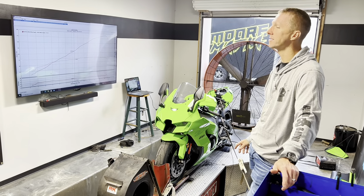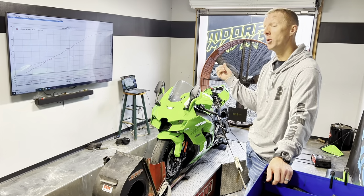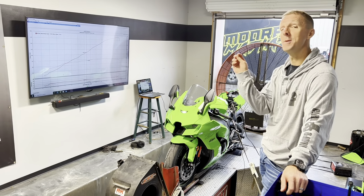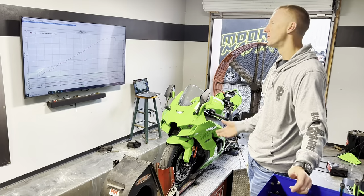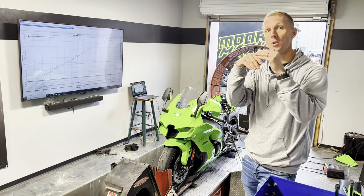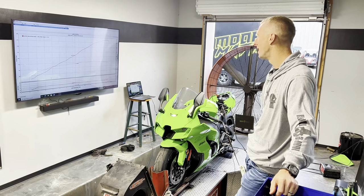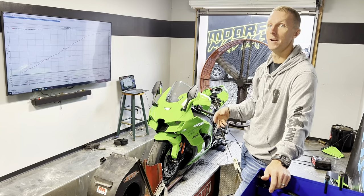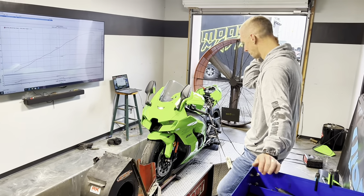So in tuning these things, I'm not going to say it's easier than people think, but it's common sense. The fuel injectors cut off when you let off your hand a certain percentage. Well, how do we fix that? We keep the fuel running. Well, what does it do when we keep the fuel running and you have a gasoline engine and you give it gas? Revs up. Yep. So when you are giving it gas and you blip the throttle, the throttle plates open and close. When it opens and they're getting gasoline, what happens? Vroom! It wants to take off. And that's why you get that jerking sensation, because you open the throttle plates, you were squirting gasoline in there, and the engine did exactly what you told it to do. That's go. I hope you guys are listening to that. That's education right there for you all.